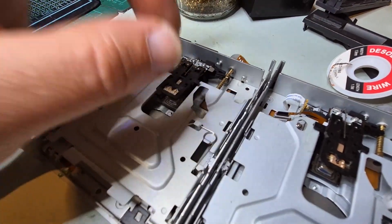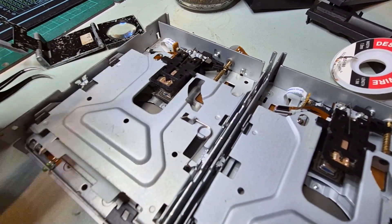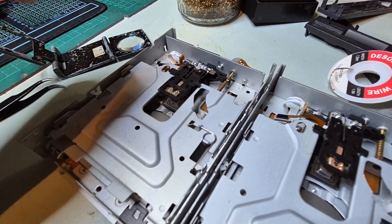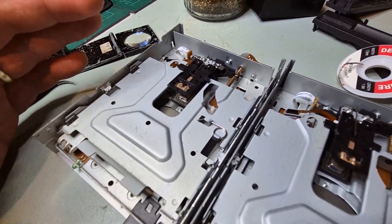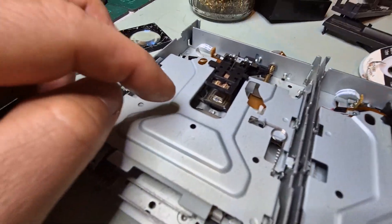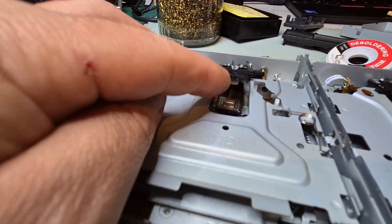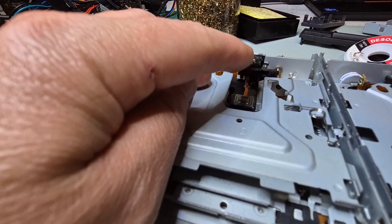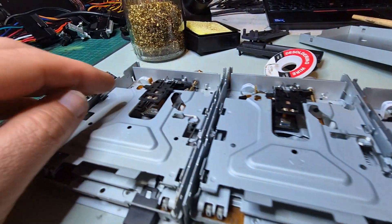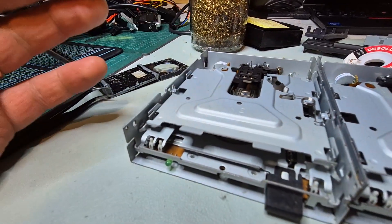To remove it, I'm just going to use cotton buds in alcohol and just slowly, carefully, just remove that and then reapply it. Avoid using cotton buds to apply it because it'll leave little threads. So we're just going to use like a stick or maybe even a screwdriver — a flat surface — just to apply it all around. And then cotton buds in alcohol to clean the head here, so the bottom. You want to be careful as well lifting this too high. There's quite a bit of give on all of these, so that's good news. Clean the top and bottom, and that's all you need to know.